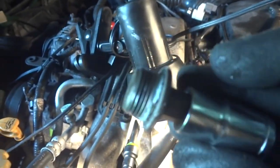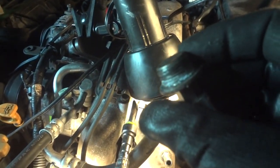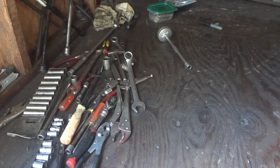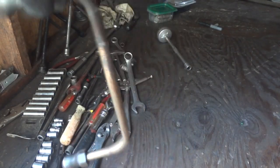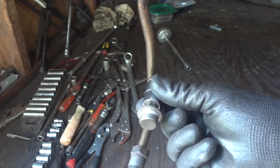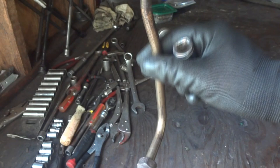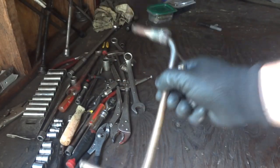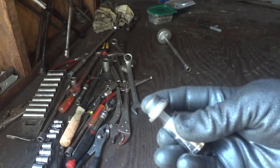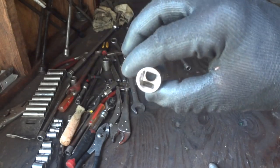The reason I'm taking the plug out before we do any of this: this way you can go to the parts store or Lowe's and try to get a connector for it, try to find something that'll work. You might have to do an elbow because of this piece kind of going off to the side. You've got a piece that goes on there like this, and this comes so close — almost directly behind it, it's off the side. I think if I can get an AN-10 elbow fitting it might work. A straight piece might still work, but you don't want rubber touching against this because this actually gets pretty hot — these are your return gases. So we'll work around this, try to figure it out. For now, we'll see if we can find a couple of pieces that'll go in the back of that head with the same threading. Hopefully it won't cost much of anything.